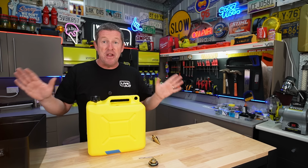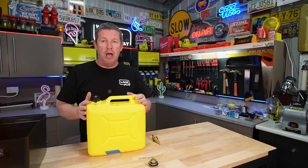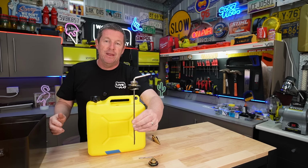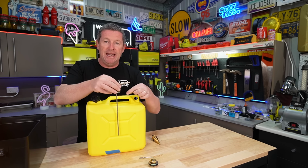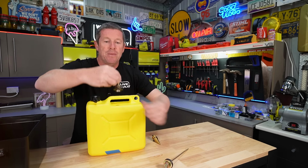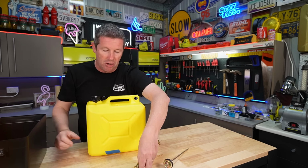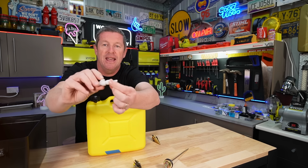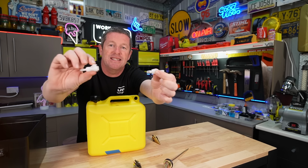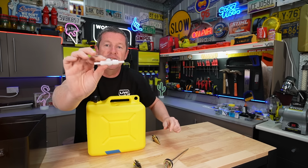Now, Diesel Heat actually have a number of different kits on their website if you go and have a look, and I'll link a few of them in the description below. The first is a DIY kit that we're doing here, and that includes this piece that goes into the tank, and it is the feed for the pump and the diesel heater itself. And then you've got a smaller piece with a barb on it, and that is the vent tube that goes onto the second hole. The most important part of the kit is obviously this quick disconnect. So you just press this and you can remove and disconnect and separate the two fuel lines that go between the tank and your diesel heater pump.